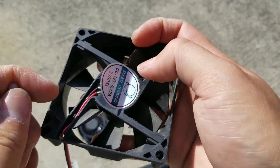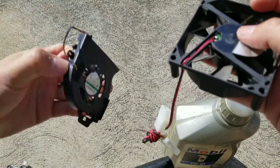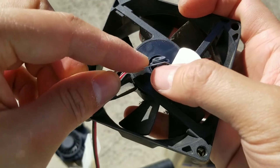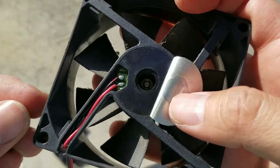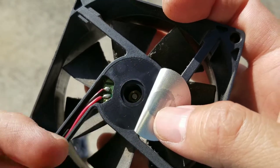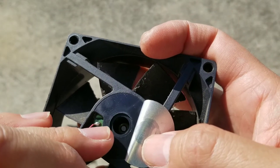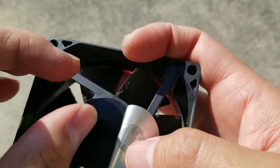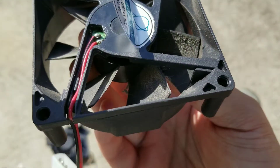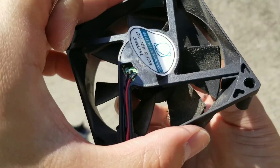When you take out a desktop fan there's usually a rubber cover on the back — though some bad designs seal it with plastic or metal. Use the needle on the edge to pry the rubber piece up. Once you do that, there's a really deep groove that needs a lot of oil, so a syringe works best; if not, use the needle droplet method but drip more. Then close it up, grab the fan, wiggle it and spin it to work the oil in — keep it upright so the oil doesn't drain to the top.